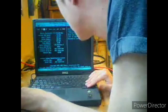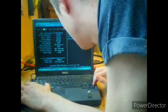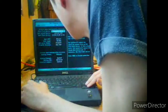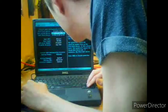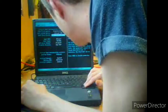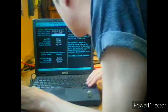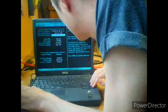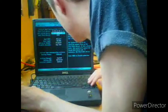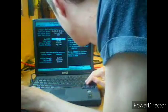So, page 1 of 6. Change values. Alt P for page. Alt P. Ooh, squealing at me now. First boot device, diskette, then internal HDD. I don't like that setting at all, so we're going to change that. Modular bay, no. We're going to change that to CD, DVD, RW drive. Modular bay, HDD, PCI slot. Last bus can be none, because we don't need that. CD, DVD, card bus, internal hard drive, okay. Boot post minimal.